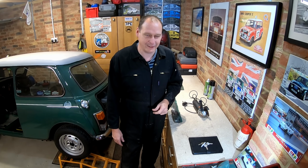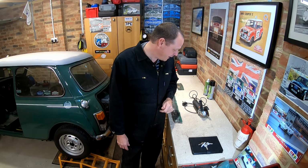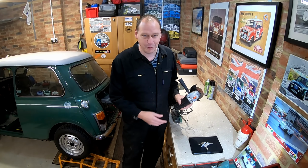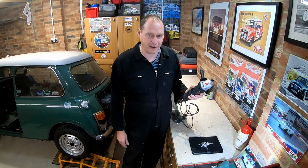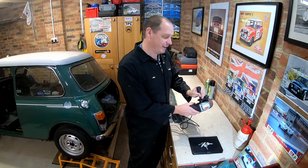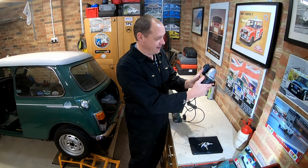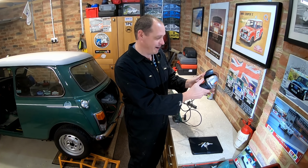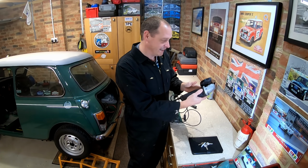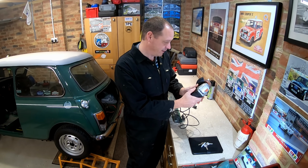I take the feedback, I take the criticism. There were a couple of failings there. The main failing, the root cause of that happening, was I wasn't using a secondary grip. If you look back, the way I had the angle grinder held was in this sort of position. So I had a one-handed grip and a steady with the second hand. That's just not good enough. When that kicks back, it's gonna hurt.